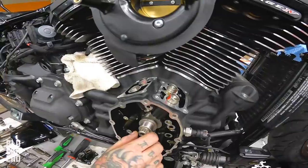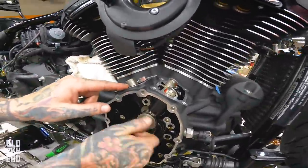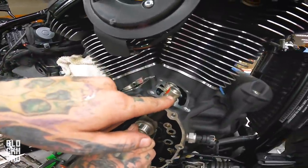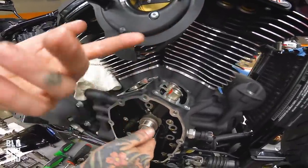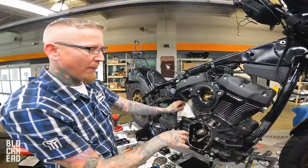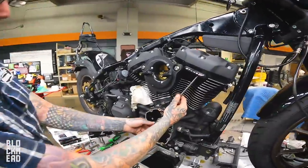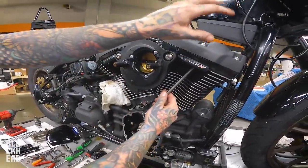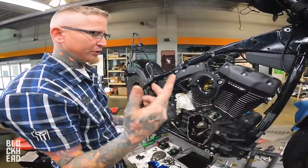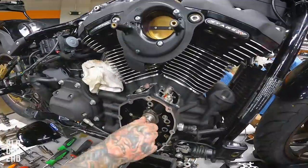That makes sense, because when your cam is spinning, and we talk about this a lot, now you can actually see it. This is where the lifters are. This is the cam. These are the bumps, right? So the bigger the cam, the longer the duration, meaning this stays up longer and goes higher. That's what we talk about when we're talking about lift and duration. For the layman, it just refers to power. So if we had all this connected, which we don't right now, but just for visual sake, if there's a push rod in there and that moves up, we saw this earlier. I already put the covers on, but remember the rocker arms. This pushes up rockers. We've been over this a few times. But for those of you that maybe have never seen it or can't quite grasp what I'm telling you mentally, now you can see it visually. So it's kind of fun to do this.